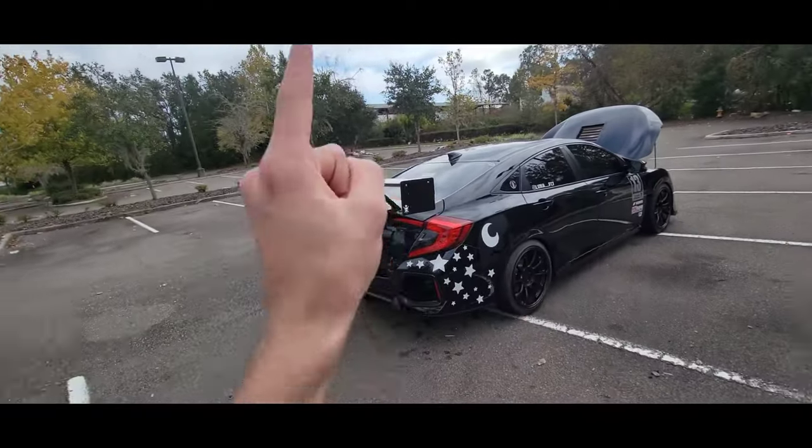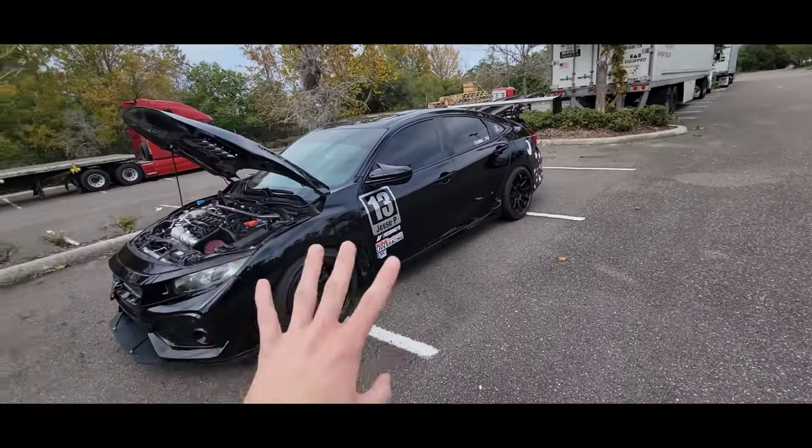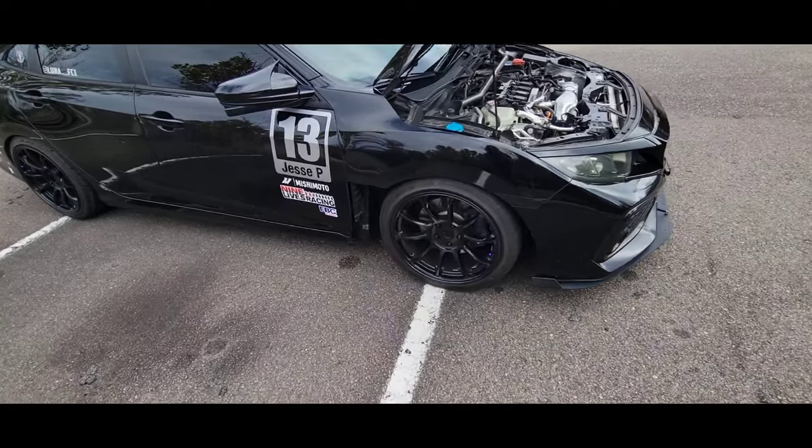The fifth thing is new wheels — and I'm talking lighter ones. The stock wheels on this car are 29 to 30 pounds each, so that's 120 pounds of just wheel — which is ridiculous. Even if you're not into racing, different wheels make the car look a lot better. The OEM wheels are okay but they're heavy. Not only can you make the car look drastically better, you can also relieve a lot of unsprung weight.